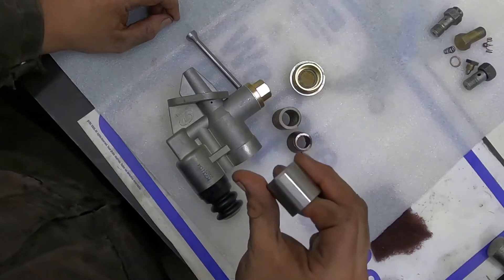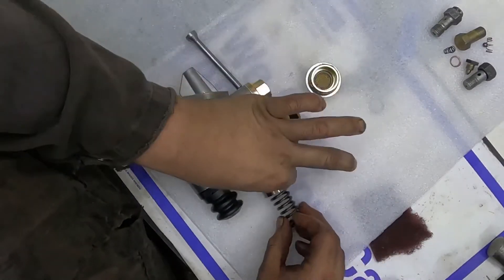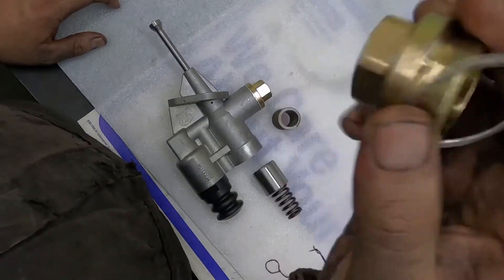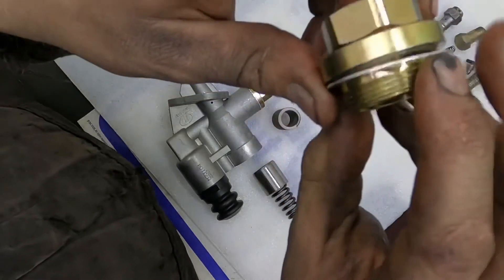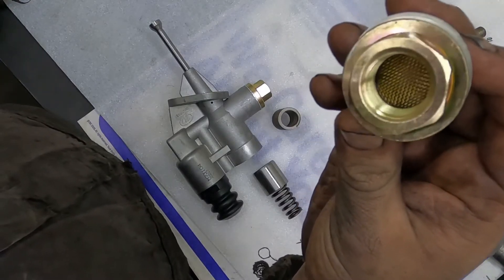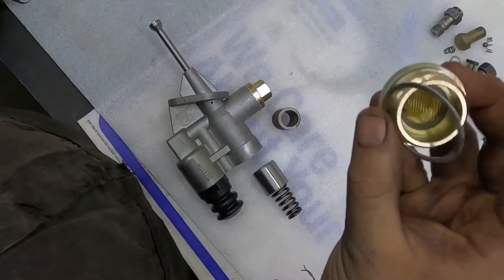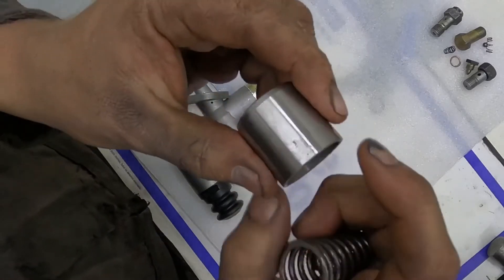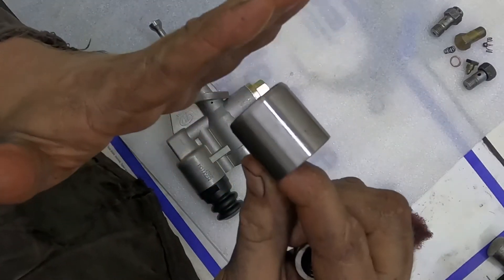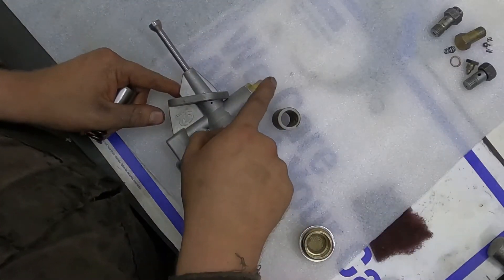You're better off to use a bigger plunger if you're doing it. You can do this to a used pump if you want — you don't have to use a new pump. The function is: this spring sits there and this threads in. There is a screen in there — you can pull that screen out if you want to. I personally leave it in there; I made 550 horsepower at the wheels with that screen in there. It could be a restriction, but unless you have a filter before it on a daily driver, I'd probably leave it there. When the plunger is pushed by the cam lobe, that's what loads the pump with fuel. Then this spring is what actuates and pushes the fuel up through the pump, and this is where your feed line goes to your engine.